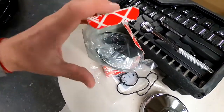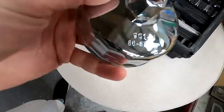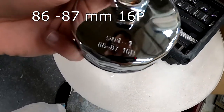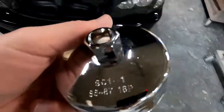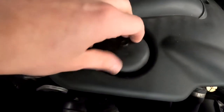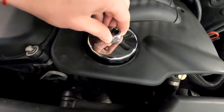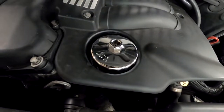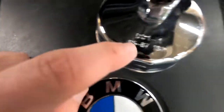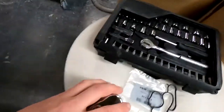As we need to take the oil filter off, you will need an oil removal tool. This is an 86-87mm, 16-teeth tool — this is for BMW and this will fit. You can see this is the oil filter cover and it's plastic, so if you take metal spanners you will ruin the plastic. But this will fit snug in there so you can loosen it that way. 86-87mm, 16 teeth — that's the amount of teeth you have in here.